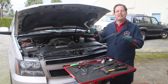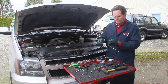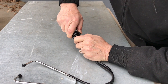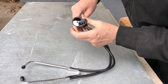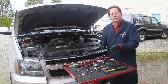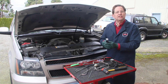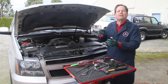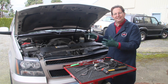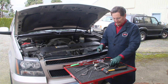A little earlier I thought maybe we could modify this — get rid of that little amplifier. So I ripped one apart and you can see this little flapper valve, almost like aluminum foil, that vibrates and amplifies the noise. But you can see the problem: if you're trying to isolate a wheel bearing noise while slowly spinning the wheel, this might work, but with a big engine running — particularly a diesel or big V8 — there's so much noise in the engine compartment that these stethoscopes just don't work.